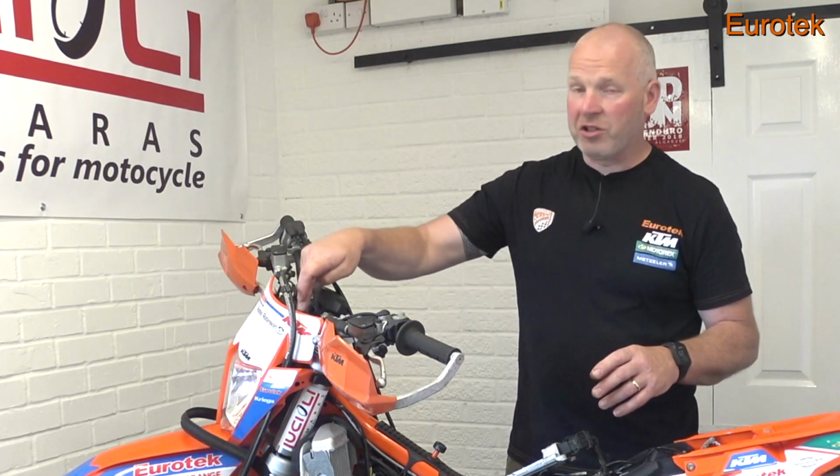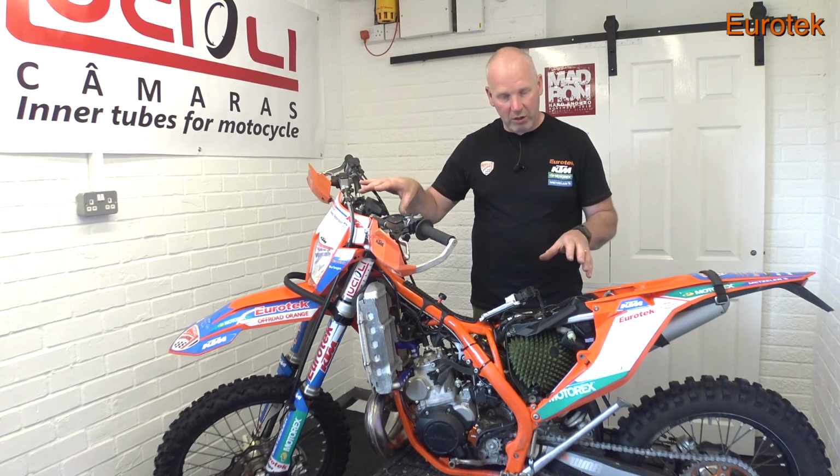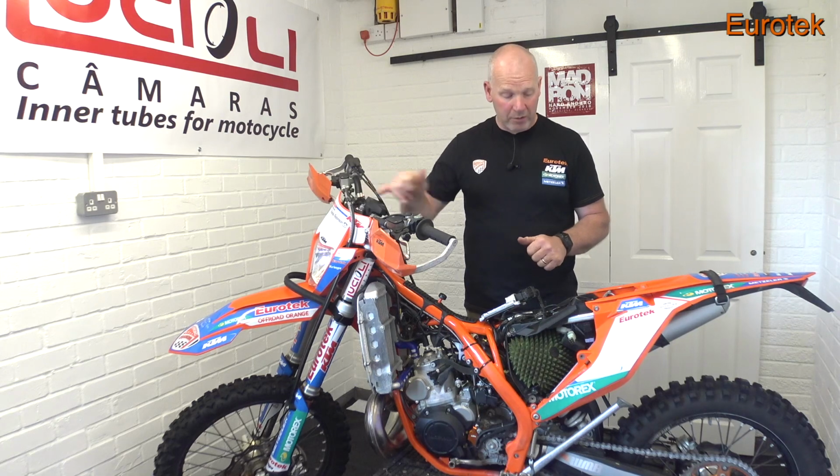Now, I have seen it on one occasion where a fuse was blowing continually. It turned out to be a faulty speedo. That's what was causing the short circuit. That took quite a bit of diagnosing. But the bike did run. It was just that the lights wouldn't work. The lighting circuit kept blowing, and that was down to a faulty speedo.